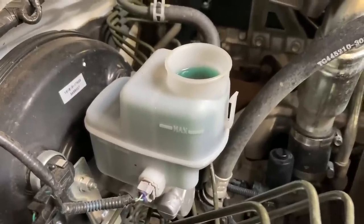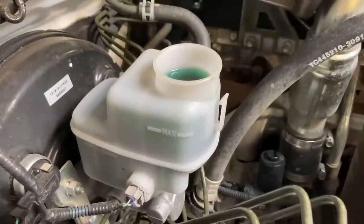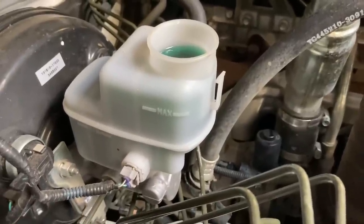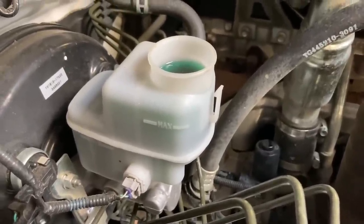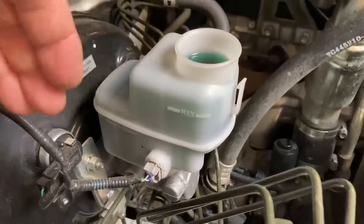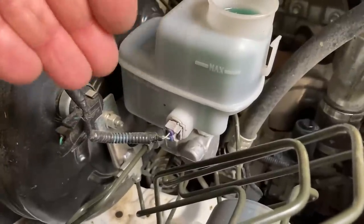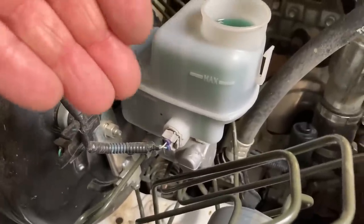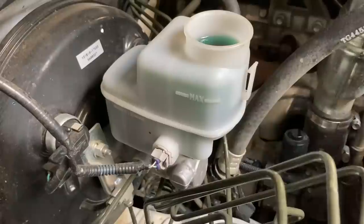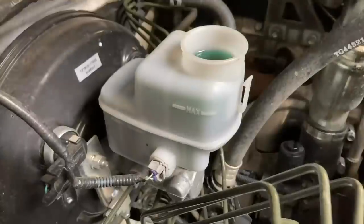And when we do our brakes, we do it again — in case we missed it every two years or every 40,000. There's no such thing as doing it too much. Those bottles are about $10 each and for $20 every couple of years, it's worth it. So if you've been watching the videos, we've recently changed the brakes on the Hilux, so in all fairness we want to get fresh fluid in there. Fresh fluid helps look after everything. The reason I'm doing this video: if you're pumping your brake pedal, this master cylinder is 10 years old. It's used to normal travel — a small amount of in and out on the brake, not going all the way to the floor. Once you've got something that's 10 years old and you don't know the maintenance on it, pushing the pedal to the floor is risky because there could be contaminants and debris that get behind the seals and cause leaks and problems in that master cylinder.